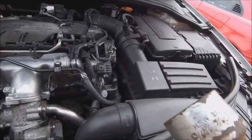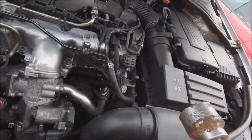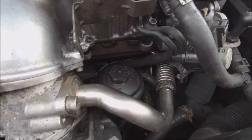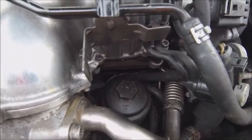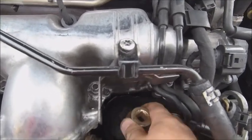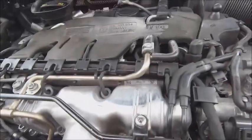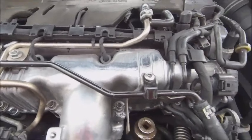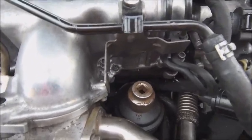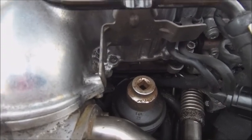This particular socket - they're so rusty I can't even see it - it's about 7/8 Whitworth I think, something like that. You can just about get it on there but it's at an angle, so it's probably best not to. Lots of people are going to take an adjustable spanner or mole grips and completely round it off - probably not a good idea. I think in modern money it's a 32mm socket. I've got a 32mm but it's a long reach and doesn't go in there. Try and get something relatively tight in there - it doesn't take a lot to turn them. I'm going to try this one-handed. That's not going to work. You're going to have to take my word for it - around about 32mm should do it.